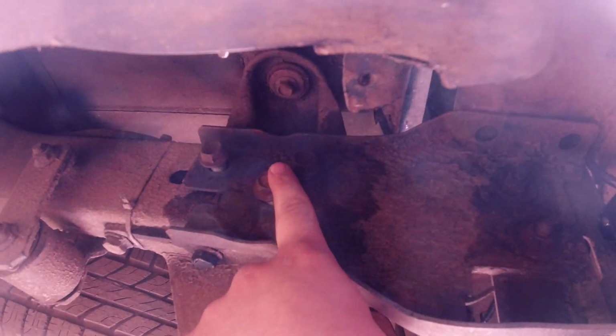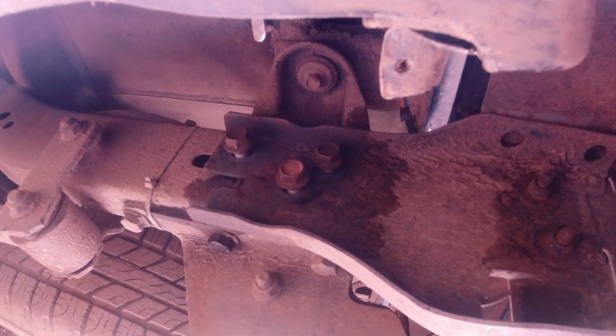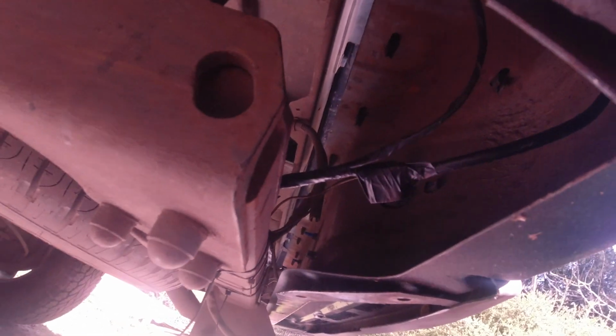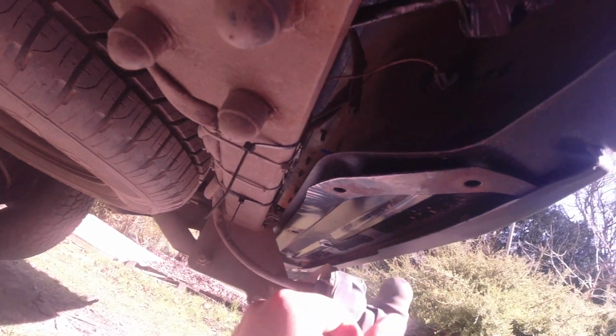So under here, that might be quite a handy thing to show actually. These three bolts here, 1, 2, 3, they're the ones that take the whole bumper off like that, and 3 bolts the other side. And then, as you can see, we've got our waterproof connection box there, and just to go extra on top, I've also used the wonderful magical electrical tape, which obviously repels all water, dust, magic and fairies, so that all works properly. Cable tied everything to the tow bar cross member, all the way through to the other side.